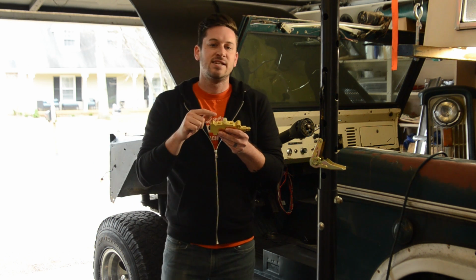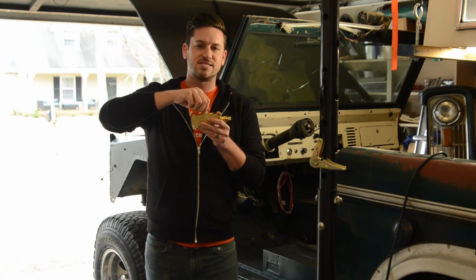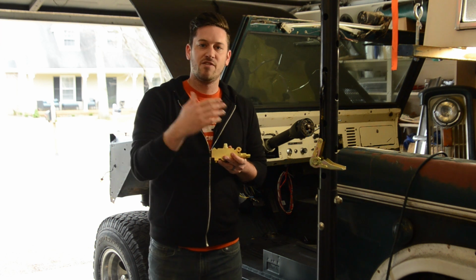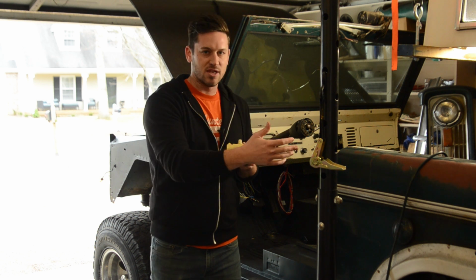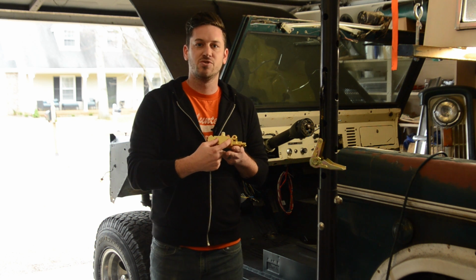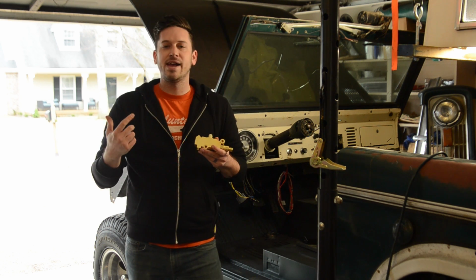This also has a pressure differential switch right up here. This is where the brake light warning switch is, but it also acts as a pressure differential switch. What that does is there's a piston inside of here. If your brakes begin leaking, that piston will recognize that there is a lot more pressure leaving this and going into the back brakes. So it's going to begin to move and close off the pressure to the rear brakes to try to keep the leak from continuing and still give you pressure up front. Pretty fantastic.